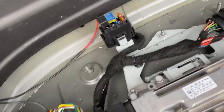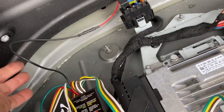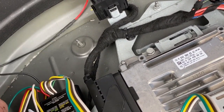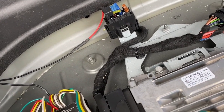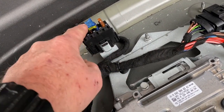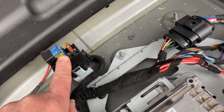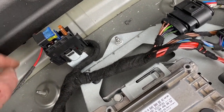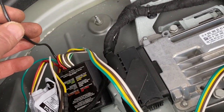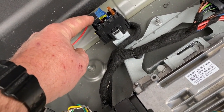I've used wire splices on this - I've used them a million times before, and as long as you use them properly you're fine. Finally, the black wire is power. You want something ignition-switched, so I tapped a fuse in the diesel - it's a 20-amp fuse - and I just put a fuse tap in there. The yellow is the original 20-amp fuse; the blue is the fuse coming out and powering my Curt hitch.